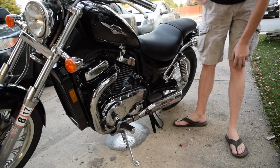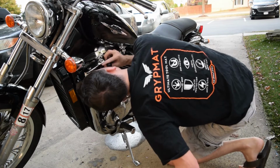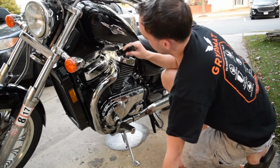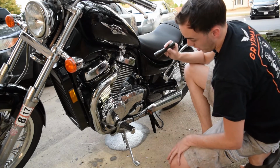See? That's what I'm talking about. Can't see exactly, but I feel like there's a fuel pump up there, or it's just dumping out of the front carb. Maybe it's out of the front bowl. I don't know. It's gonna take a little while to figure that out, but the fuel tank will have to come off, and then we'll figure it out from there. I'm gonna let this evaporate again, and then we'll try again.